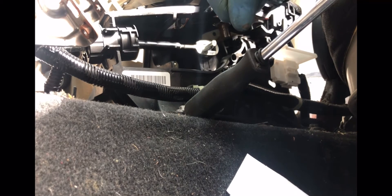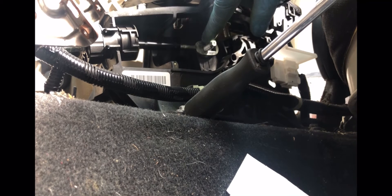With the 14mm socket, I have to remove this nut right here. As you can see, the cable has a large grommet right there, which means I can adjust this cable. So if you don't want to have a problem with the position of the shifter, you have to mark it with black or white paint to know where the cable was before taking it out.